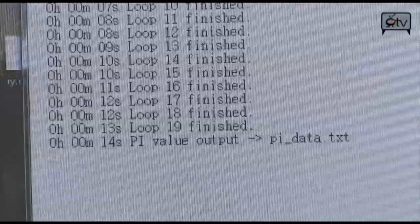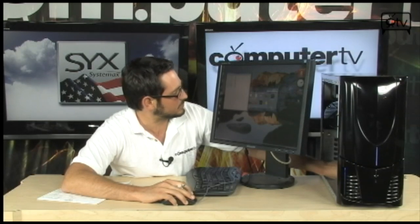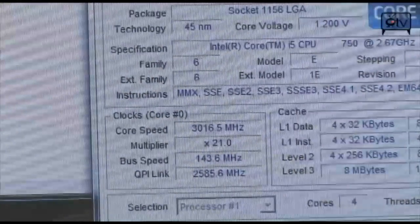And just to give you a demonstration of how fast this little overclocking thing works, I'm actually going to push this button over here a few times, just randomly, haphazardly pushing it. Actually, if you want to see, I will turn on CPU-Z, and you will see that my base clock frequency has increased, and so in turn has my frequency for the CPU. Very, very fast system. Gives you pretty much all the benefits of the Nehalem architecture.